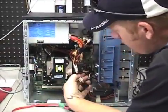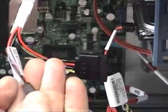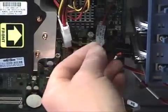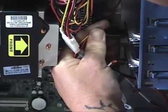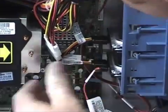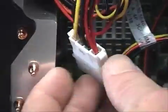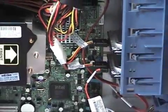If you're unsure which connector is power, you can see from the other hard drive that the actual connector is labeled 'Serial ATA.' If you're still confused, look for another one inside your computer coming from the power supply that looks like the one already plugged in. The power connector is actually a splitter installed by HP coming off a standard Molex connector — not all computers are like that; some will come straight from the power supply. Now we have power, and all we need to do is hook up the Serial ATA data cable.